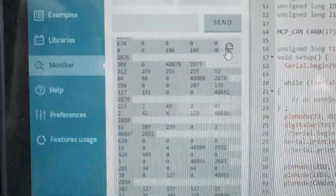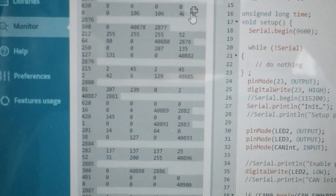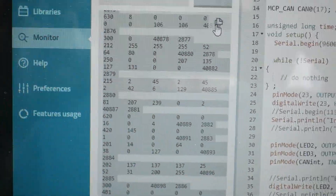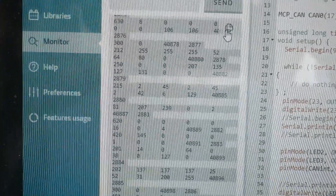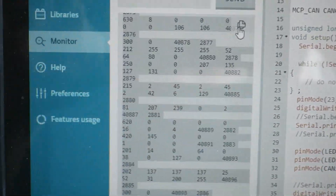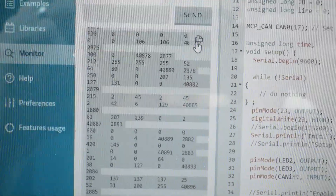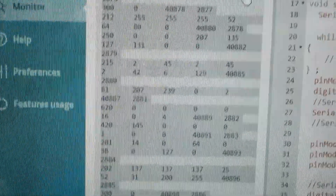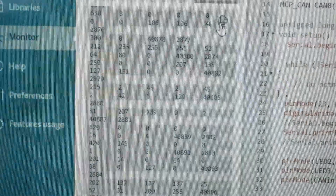All you have to do from here is copy this and paste it into something like Excel - it then becomes a lot more readable and usable. You can do things like put a pivot table on it and find all the control codes that your CAN bus is sending out. CAN bus is just a noisy protocol - every device will be sending out what it wants to send out, nothing will acknowledge that. Your wheel speeds will just keep sending what their wheel speed is, and other things on the CAN bus will be listening and using that information for lighting up lights, ABS, and all the bits and pieces.